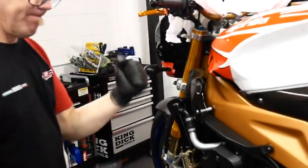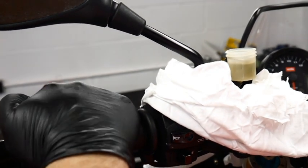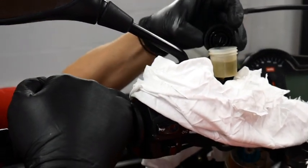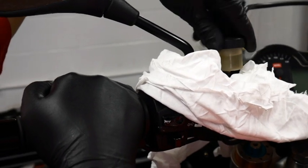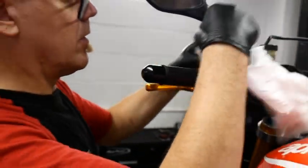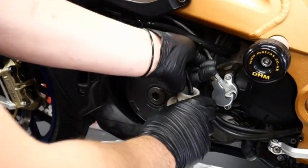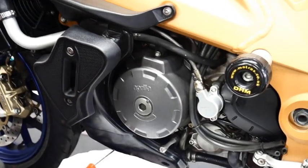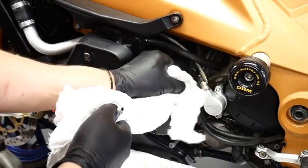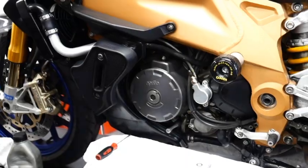Job's a good one. Just another little top-up and that should be completely done. Give the lever a test — there we go, you can see the effort it's taking to pull the clutch in. Make sure the reservoir isn't over full — there is a maximum level marked on the reservoir itself, so make sure you're not above that. Remember to fit your cap, give yourself a wipe down, and make sure everything's clear and clean. Don't forget to fit the dust cap over the actual bleed nipple once that's done. Effectively a bit of a tidy-up, job done — that is probably less than five minutes to bleed a clutch system.